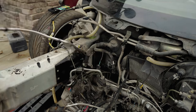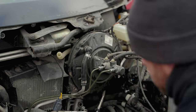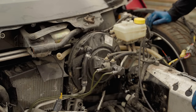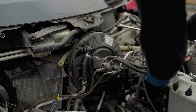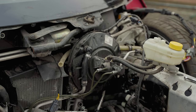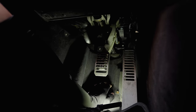We got it! This project holds a lot of firsts for me. To be honest, I had no idea what this pancake thing was since I've never needed to replace one before. I assumed it was a steering component, but in fact this was the brake booster — the part that takes the direct braking input from the brake pedal. I found out it's removed from inside the cabin: you disconnect the linkage from the brake pedal, remove three screws holding it into the firewall, and it slides out from the front. First time removing a brake booster.